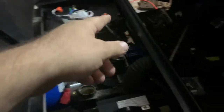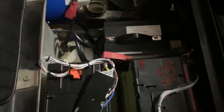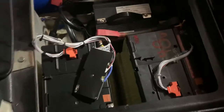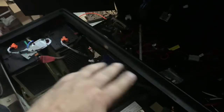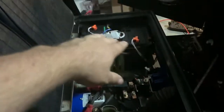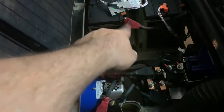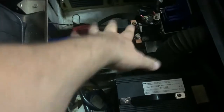Another major milestone today — the batteries are in the car and all the battery cables are connected. I got a bunch of cables from a local who's also enthusiastic about building a city car. He lent me tools to make some custom cables, so I made two long cables of the same size going between the two sides. I now have four 48-volt battery modules, all connected in parallel, with the main negative and main positive coming together to supply power.